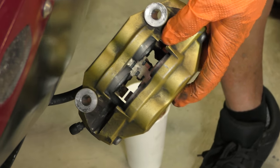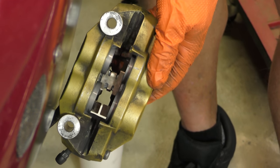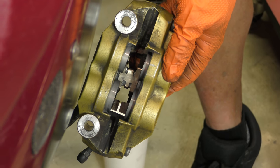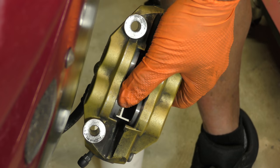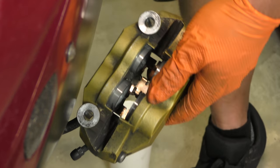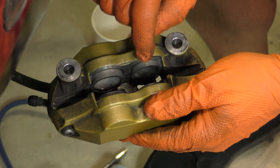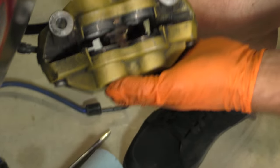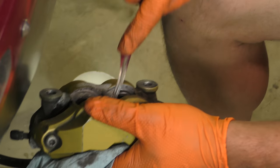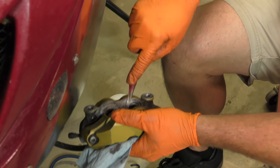Now the caliper is clean. The other caliper is mounted and in place with the bolts intact. So now we're free to squeeze the brake lever and see what pistons move and what pistons don't move. These two are pulsing — that one's coming out first so that's the cleanest one. As it came out we'll scrub a little more, then we've got to hold that one still, pump the lever again and see which one moves next. A quick scrub on this — leaving the soap on it isn't a bad thing. When it dries it'll capture some of the brake dust and stop it pitting the piston surface.